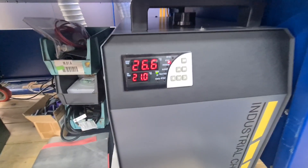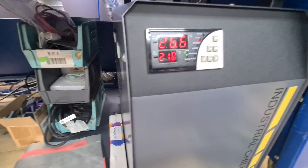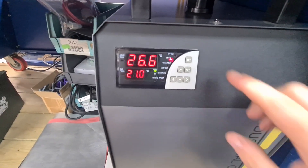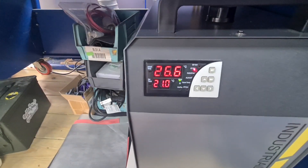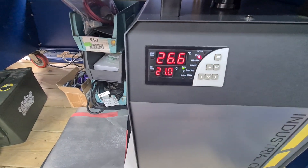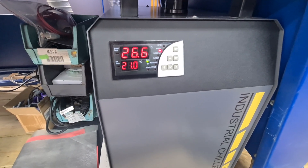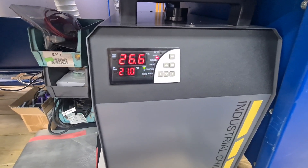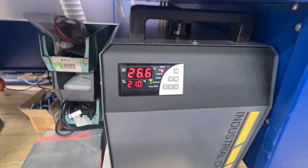In Function 3, if it's set to 0 it's in constant temperature mode; if it's set to 1 it's in intelligent temperature mode. Change it to 0 and confirm. You'll hear the compressor kick in as it tries to bring the temperature down from 26.6 to 21 degrees. To change the target temperature, just push the set button, change it to whatever you want, then push reset to confirm — it's now locked in at 21 degrees.